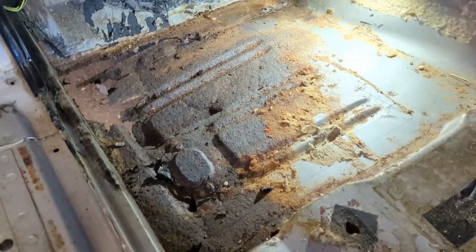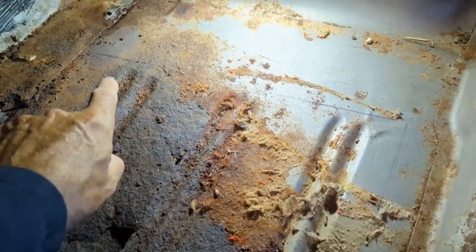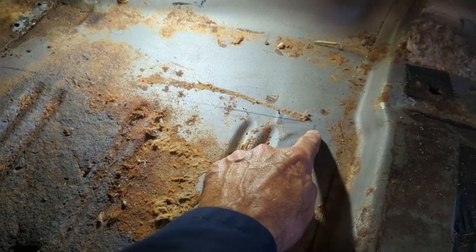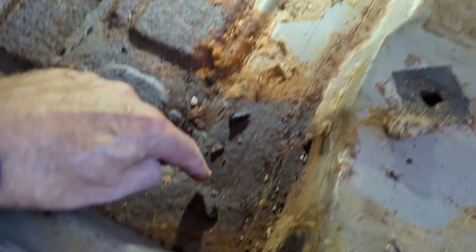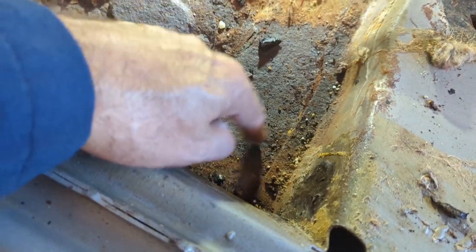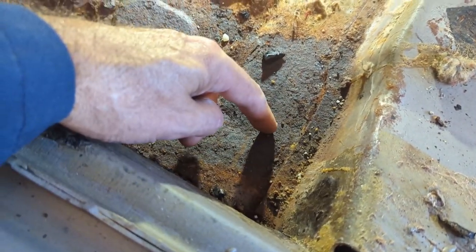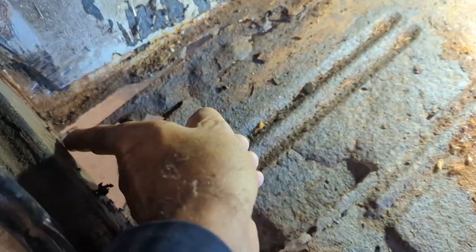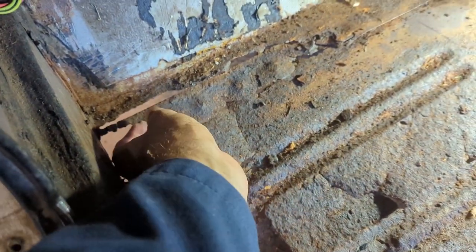I've marked off an area roughly where I want it to be, avoiding any rust areas and trying to avoid the frame rail that runs in there. I want room to weld both sides and not on top of the frame rail underneath. I'm going to cut along there right into here. If it's thin in here I'll put a piece in — this is easy to do. I'll leave some on the panel and cut it in straight. I can replace this hole with just a strip of metal, and the floor pan goes up underneath.